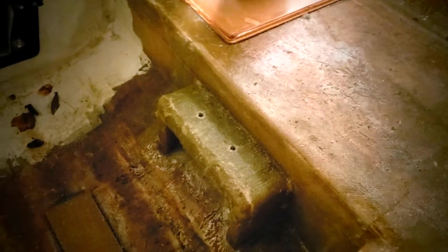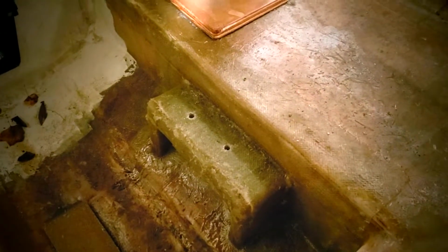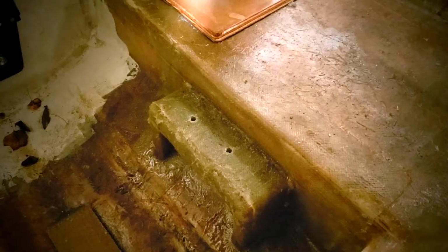There's no exposed wood. I'll also go back and coat the outsides of the holes with some gel coat when I do the back, so that'll make sure they're totally sealed. And I'll put some 4200 or PL4000 in with the actual bolts.